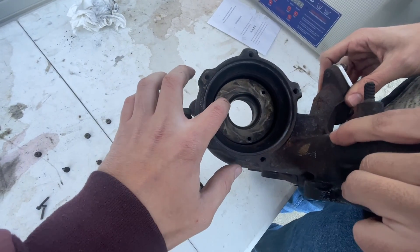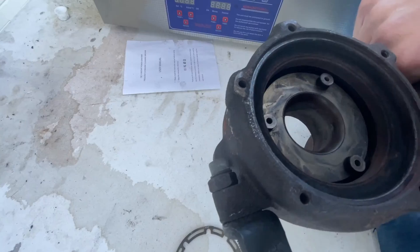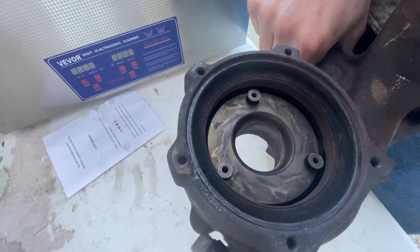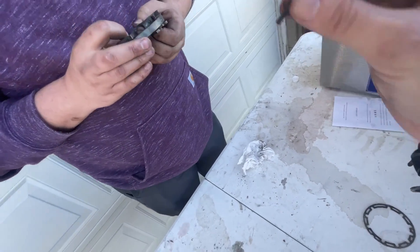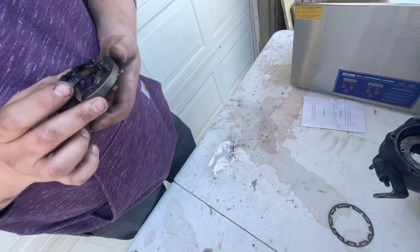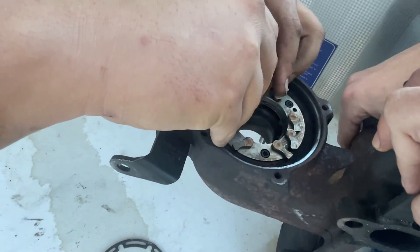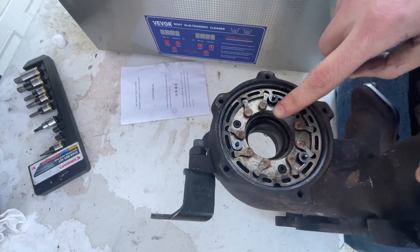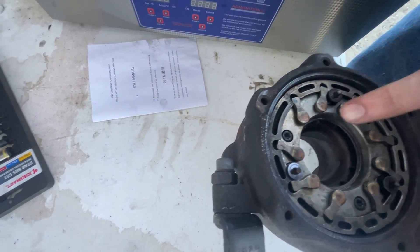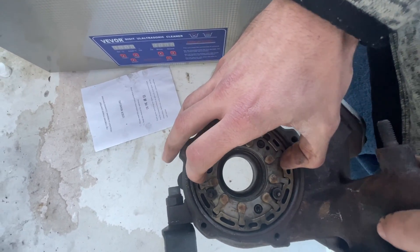Going to start reinstalling into the turbo. There's a ring right here — you've got to make sure all these holes line up into the casting. Go ahead and put these little standoffs back in. They kind of move around so put it back in here, line everything up, and get the unison ring back in. Make sure you take a couple pictures when you take this thing apart so you can put it back together correctly. When you move it in this direction, make sure all of these are the leading edge — the pointy side of your vanes — and rotate the other way.